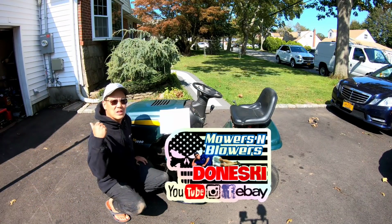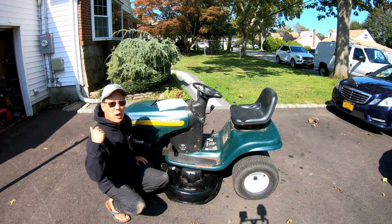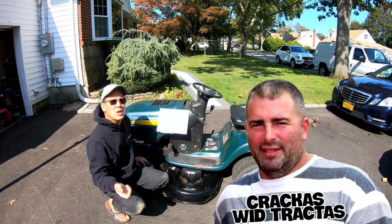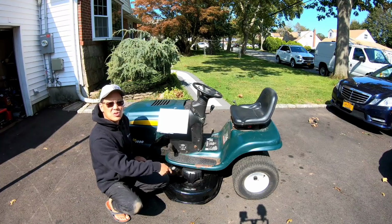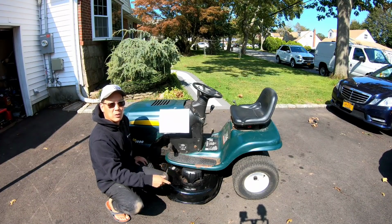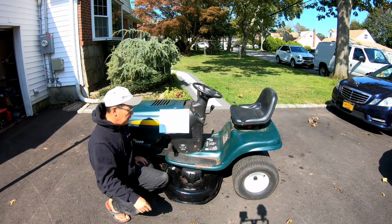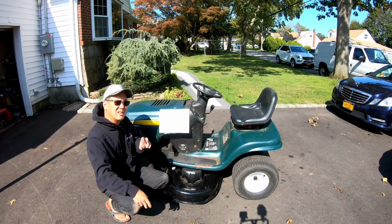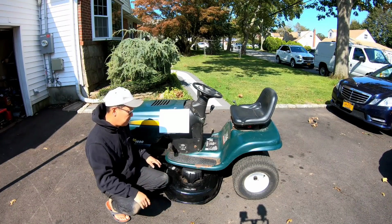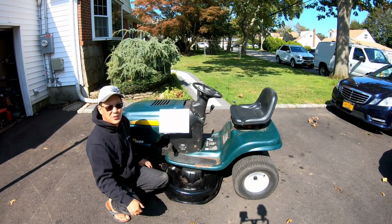So I basically took it off that second carcass of crap that I got from Nick from Medford. It was also a cable-driven PTO, so I just took that cable off and put it on this one. I loosened up all the spindles and pulleys here and changed the belt with another one that I had in a little better condition. Not a lot better, a little better. Then I ground down the crap on it, the grass, the leaves, the dirt, the mud, and the rust, and gave it a new paint job. We put it on, it works fine.